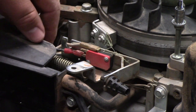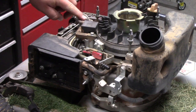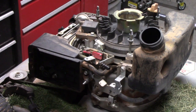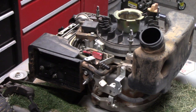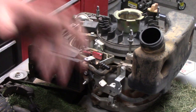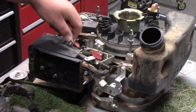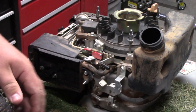These are all going to be a little bit different and I can't tell you exactly how yours is going to be. But basically this mechanism here creates the electricity that runs down into your spark plug and creates a spark in your engine. Essentially what we're doing is putting in a toggle switch — instead of grounding out the electricity to your spark plug and shutting off the engine by starving it of a spark, we are going to run it to a toggle switch that we can switch to ground it to the lawnmower. So I'm going to remove that wire and start running from there.